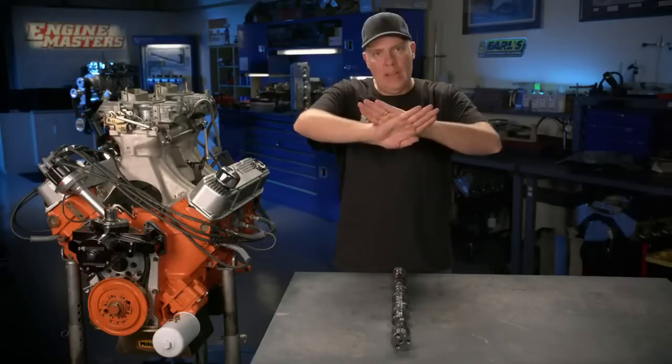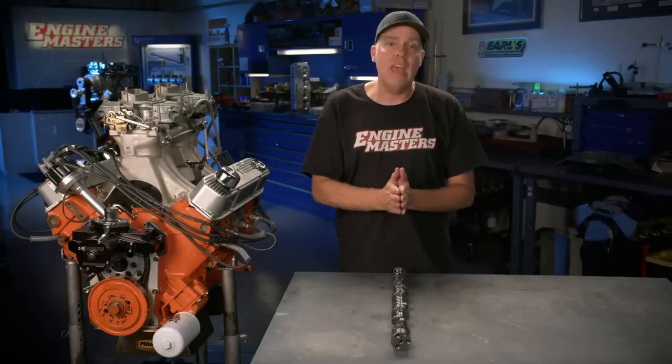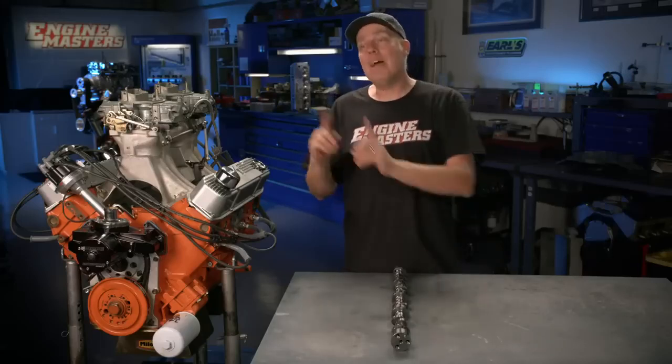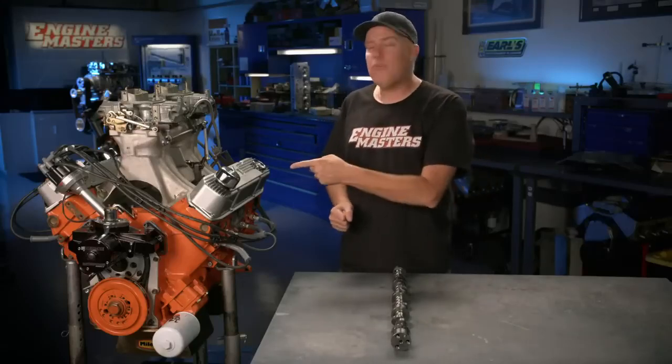However, it tends to make much beefier mid-range torque. When you widen out that lobe separation angle, you smooth the idle. You get greater vacuum, and that's the reason you see it in a lot of EFI applications. The other thing that wide lobe separation does is favor the much higher end of the RPM curve for the camshaft, at the sacrifice of mid-range torque. So our plan is to run those 3 camshafts through that 440 Chrysler.